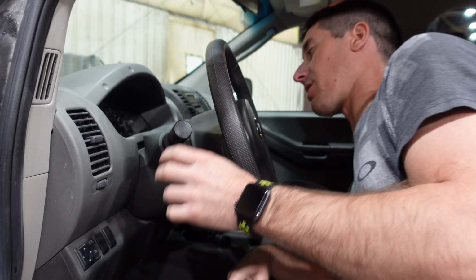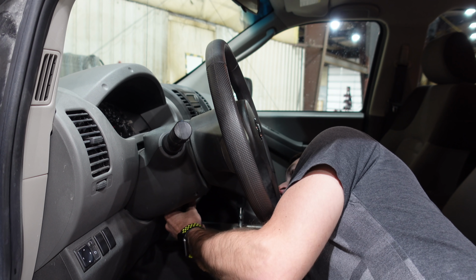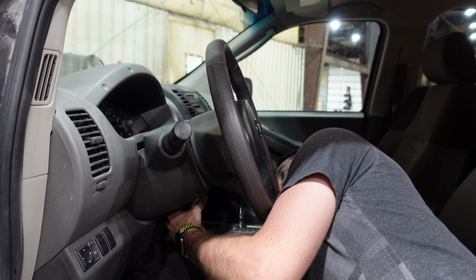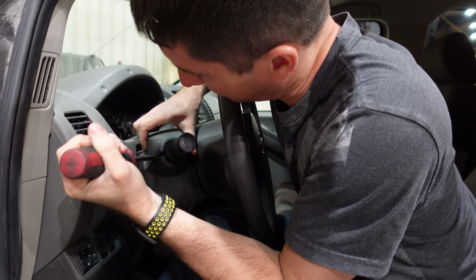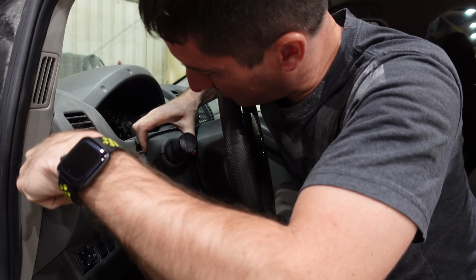We're going to start by changing out the switch. There's 3 screws here. They're Phillips screws, and you're just going to unscrew them. Should only take you a few seconds, and then pull the top cover off and the bottom cover down a little bit. I think we've got that one out. Usually this trim comes off a lot easier than this, but today it is fighting. Okay, there we go. Just kind of work around it with something to pop the tabs.